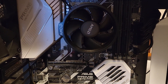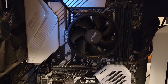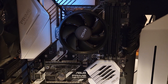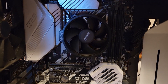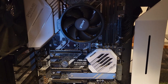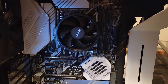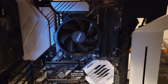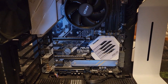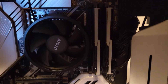I honestly don't think you need to upgrade the GPU. Even if you did want to go to an RX 6800 XT or a 3080, you could undervolt them and make them work on a 650-watt power supply. If you wanted to go higher, you'd just buy a new power supply — you'd need 850 plus at that point, and at that level you're not in the budget space anymore. I think 750 watts was not worth the extra money. 650 gives you more than you need and some upgrade ability down the line.